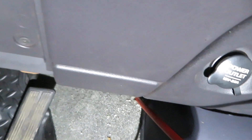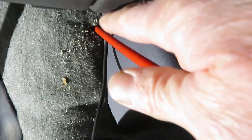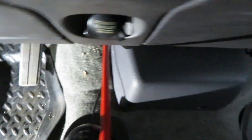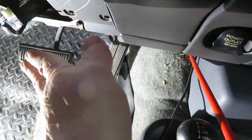I got my shifter made and bolted from seat bracket to seat bracket — everything's buttoned up and put back together. I did remove the sticker and moved it just a little bit to have everything line up better as far as the shifter itself, where it pulls the indicator. As far as the cable, I drilled a hole right there beside where the airbag cover — or the computer for the airbag — is. That comes out just about right at the starter, and then everything will loop back around and come into the transmission. I didn't want to move it over any further because we would have been on top of the four-wheel-drive shifter. We're pretty close as it is, but I should still be able to get my hand in there and put it in gear. The cable goes out just a little bit around the starter and then comes down and around.